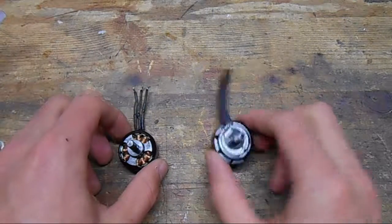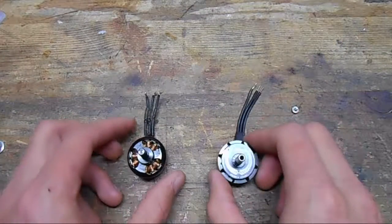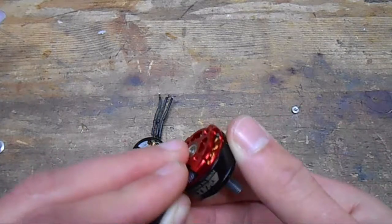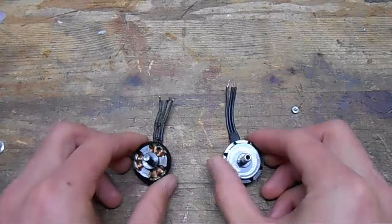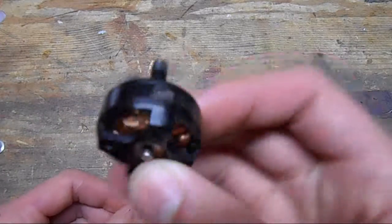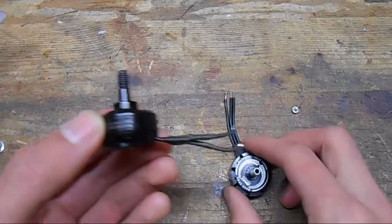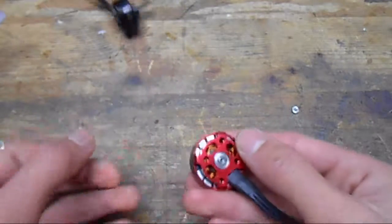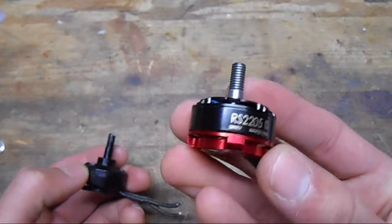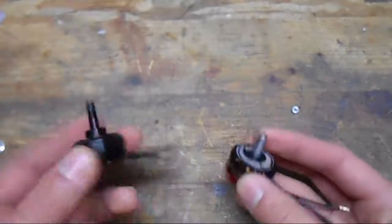Hello everyone. I'm in the process of upgrading the motors on my Alien, so I thought it'd be fun to compare these motors and just newer brushless motor design for mini quads in general to something older. This is the old king, basically, which is the Cobra 2204 — really a 2205. We're going to look at the differences that make this one put out about 200 grams more thrust at the same efficiency in terms of grams per watt as this Cobra.